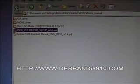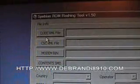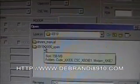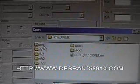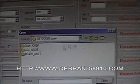Now we've got all the drivers installed, we're ready to load the ROM flashing tool and get started. So let's double click. There's a few things here, but it's pretty straightforward. To start off with, we need to point the software to the correct files. If we click on code XML file and go into our folders, there's your code folder and the XML, and repeat that for the next one. And for the last one, the folder, and there we go. We've got all our files selected.